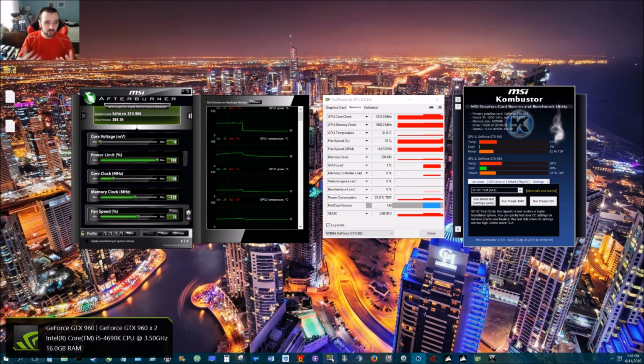In some cases, if you're really overclocking the hell out of your cards and you're only getting 10 frames per second or 20 frames, 20 is okay, but a 10 frames per second increase is not really worth the extra stress on your card. So that's why there's so much testing and time that has to go into overclocking. But in the end, it is absolutely worth it when it comes to games that require a little bit extra performance. Now I've got my GTX SLI'd to perform close to the Titan as far as FPS with certain games with proper overclocking. Now I'm not a professional overclocker by any means, but once you overclock a few cards and you go through the trial and errors and you crash a few cards, and there's nothing wrong with having your graphics card crash, you just start to learn more.